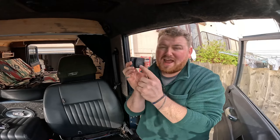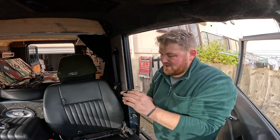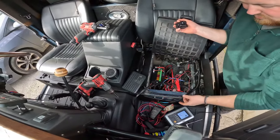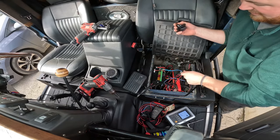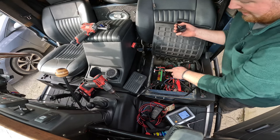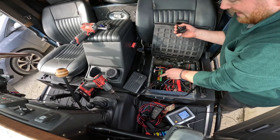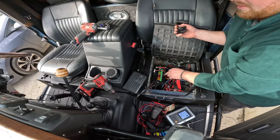Next thing is to get this Scan Strut 12-volt cigarette lighter charger installed in the back. Thankfully I now have the terra firma panel — I've already got a cable coming out in some conduit that runs into the box where I'm going to drill a hole for this to go. The panel is already fused and the switch panel up there controls all of these, so all I need to do is put the wires in and screw it down. I'm going to go for the 10-amp setting. Now I need to get the voltmeter and work out which button does which — really excited about that.